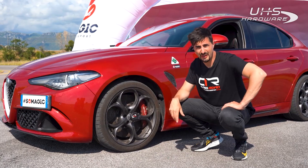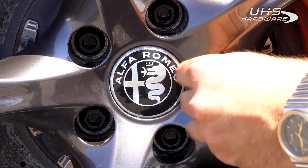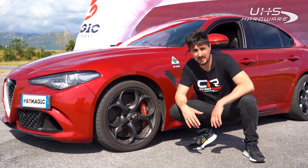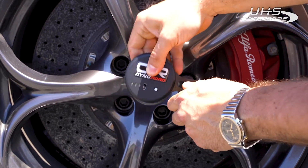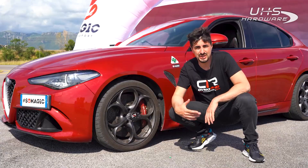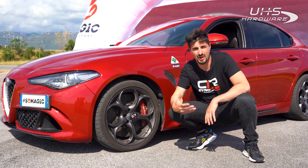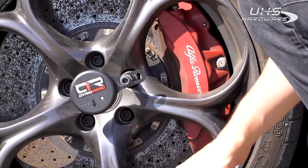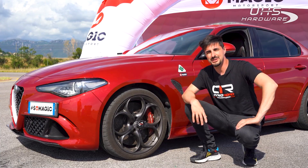To install the device you need to use the accessories in the kit and follow the instructions to position the Dyno Road on the wheel. A very important thing is to place it on the wheels that have no traction — because if the wheel spins, the results will be incorrect. It also needs to be on the driver's side so the connection with the smartphone will be stronger. Make sure the device is centered with the wheel. Now we download the app, connect via Bluetooth, and we are ready to go.